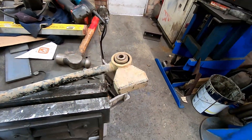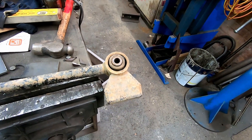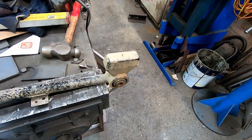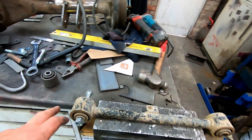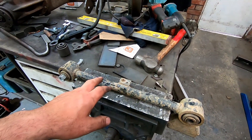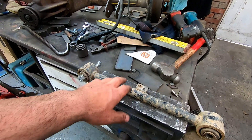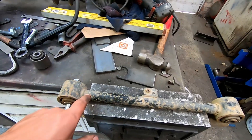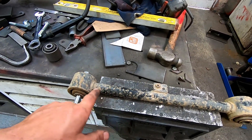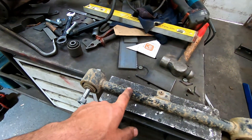I will have to cut that thing off — I think that must be for vibration or something because it's quite heavy. These are upper arms and because they're not out in the elements — no rocks or hits will get them — these can be quite lightweight. So we might put it in the lathe and just machine these down a little bit and sleeve over the material I've got.